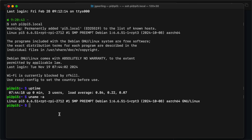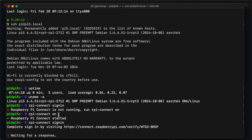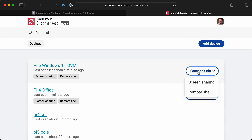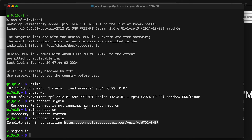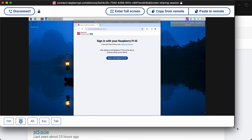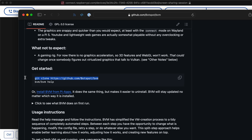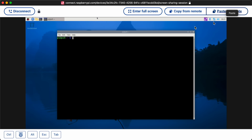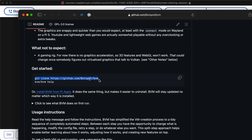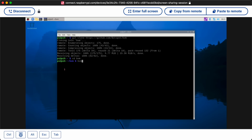I don't like having to plug in a keyboard and mouse to my Pi to get connected to it. So I'll run rpi-connect on and sign in. I can go over here and connect via screen sharing now. Instead of having to use SSH, I can get out of there. Getting started, you just use git to clone this BVM project and paste to remote, then CD BVM. And it's dot slash BVM help.